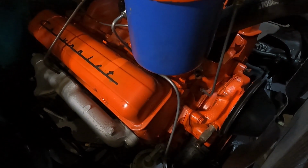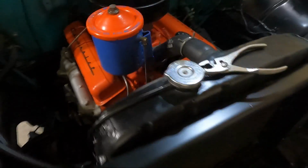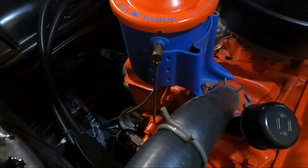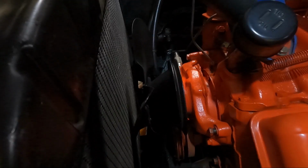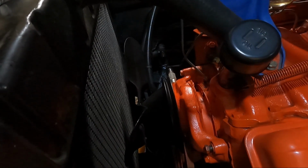And I'm having trouble getting the water pump one freed up. I know that I've got a huge mess. Most of it hit the pan, but you still have some dripping down there. But either way, I'm gonna see if we can get that lower radiator hose loose and then this upper. And then, like I said, I haven't even messed with the transmission lines down there. I guess I need to pop those loose as well.